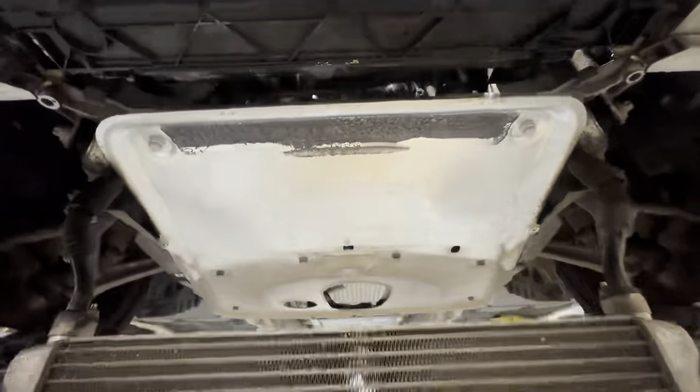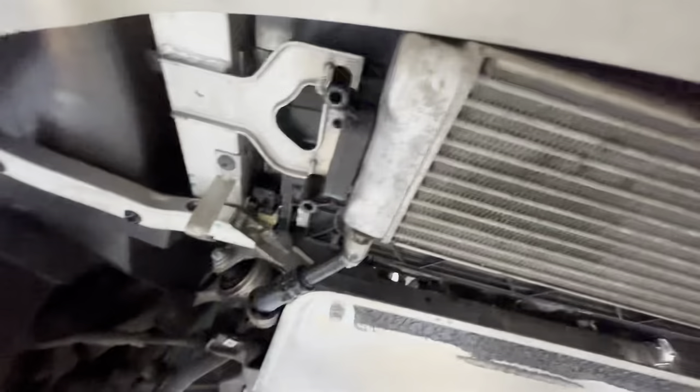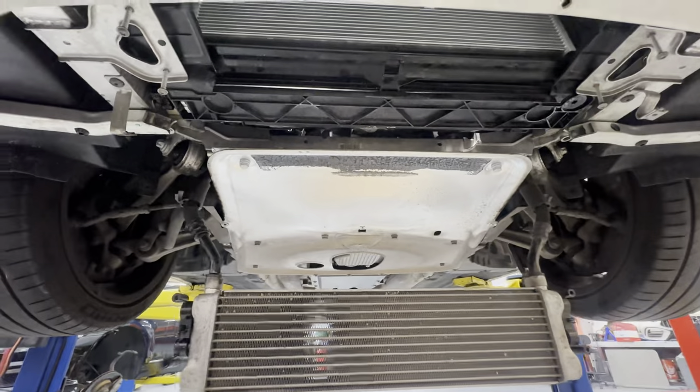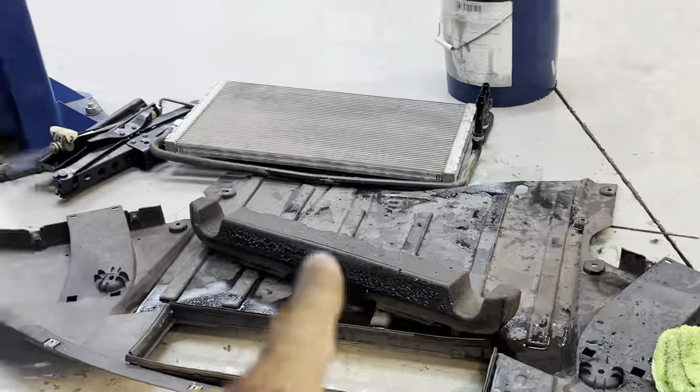Here's the oil cooler and here's the new radiator that we installed. This clip — there are four bolts on each side, two there and two there. I left them still in place and I believe they're Torx T30s. After this, fill the cooling system — both banks, there are two circuits on this car. Don't forget a high and a low — bleed the system. Check for leaks obviously; don't put any of your panels back on. That foam piece goes right here so don't lose it. Here's where your fan clips in, one there and one there, and then the bracket for the water pump clips into the top right there.